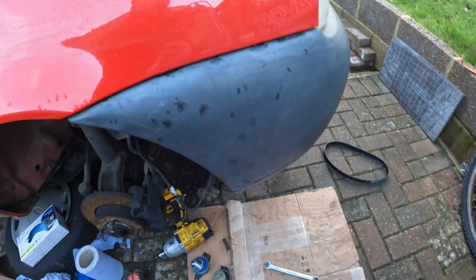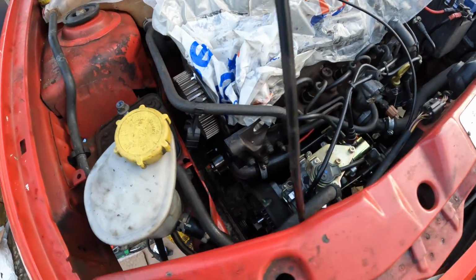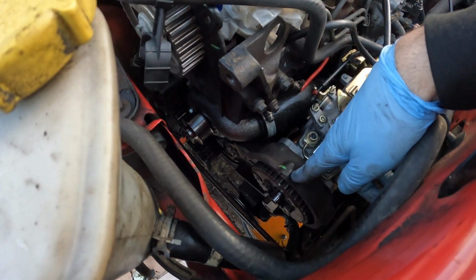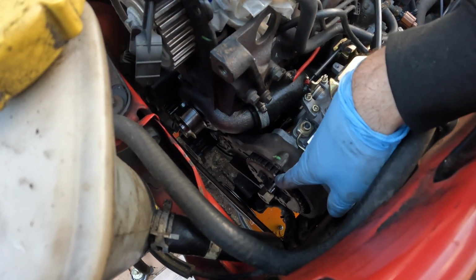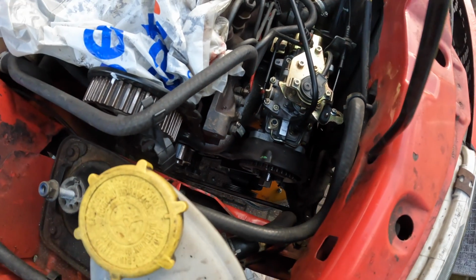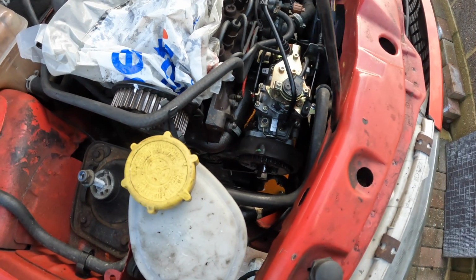I've also got my timing marks, well, my belts and braces timing marks, as we can see down here, my Tipex mark, which is just visible here, and the Tipex mark on the tooth of the sprocket. Now if we come bang on up here, you can see they line up perfectly, so I'm very happy that that's all timed up. Yeah, I can't really stress this enough.